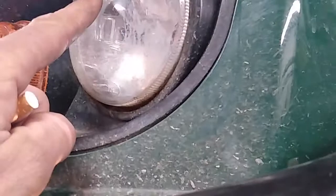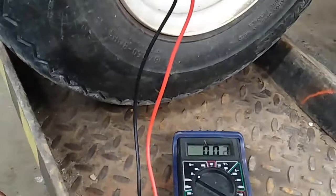The lights will operate when the key is turned — the accessory key is turned on the cart. That meter should go up to almost 13.5 volts or so. Let me turn this key on. Key's on — and there we go.